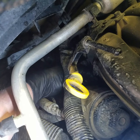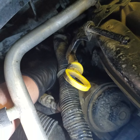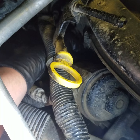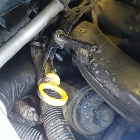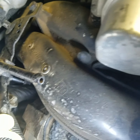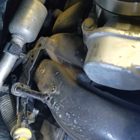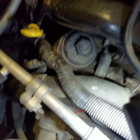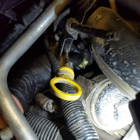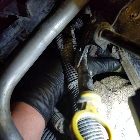That's one thing to think about if you take that out. I'm going to be doing an oil change so I don't really care that it came out — it will be replaced anyways. Then you just replace it, put it right back in the same spot where it came from. You can tighten it up with your hand, then take this tool and put it right back on there, then just use the ratchet and tighten it up all the way. Once you've got that tightened back up, you'll have to plug that right back in.